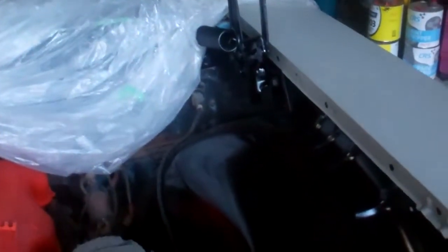So the thing that prompted me to respraying the underside of the hood here and the wheel covers, and I'll end up doing the fan shroud and that sort of thing, was basically that I'd originally done this in a semi-gloss black, and I didn't have enough thinners in the mixture. So when it was finished and dried, it just looked like there were spiderwebs running across the actual paint job, and it was very rough to the feel. So obviously I didn't prepare it correctly, which is a lesson for not doing a test patch before actually spraying, but that's what I did. But I'm glad I redone it now.